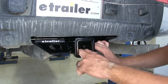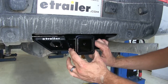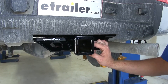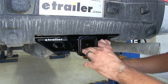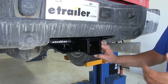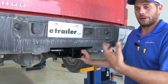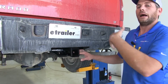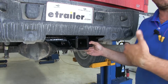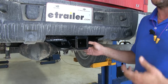I like this hitch because it's rated for Class 5, but it's got the 2 inch by 2 inch receiver tube opening, so this is going to allow it to have a lot more adaptability. You can use Class 3 bike racks or cargo carriers or Class 3 rated accessories in it, as long as they're rated for the capacities in which you want to tow and haul. If you're going to use it to its fullest potential, then you'll want to use a 2 inch Class 5 rated ball mount or something rated up to the capacities you intend to haul. It's rated very highly as far as tow weights and tow ratings go.